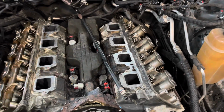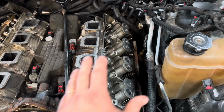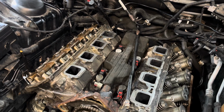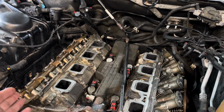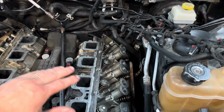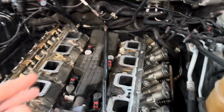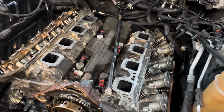I don't think there's really anything else critical to tell you. One thing is I made a mistake and I ordered head bolts, and I didn't realize that it's per side. So I only had one side of new head bolts, and on this side I reused head bolts. I know there's a lot of people that will cringe at that, but they're supposed to be reusable. If the threads aren't stretched or anything, then they're okay. They seem to be totally fine because you go 25 foot-pounds on all of them, then 40 foot-pounds, and then you turn them 90 degrees. From everything I found online, when you go 90 degrees, they should be at right about 95, and every one of them hit 95. So I'm not too worried about that. I think they'll be fine. I would have liked to have had the new ones, but it's not a big deal.